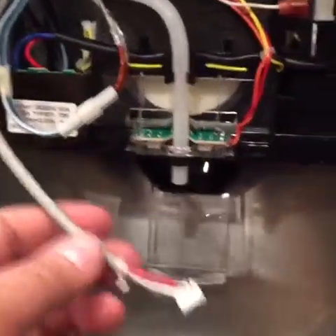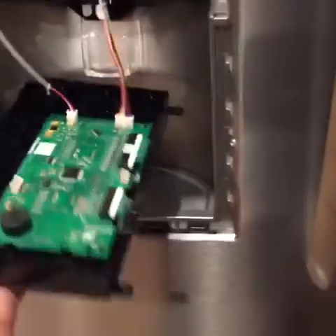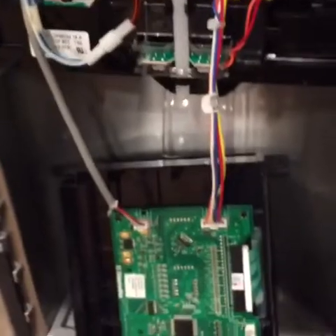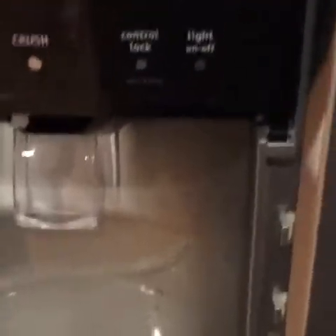The next step is to connect this panel. I'm going to hold this up with one hand and put this back on, along with this harness — it only fits one way, so you're not going to screw anything up. When you connect the panel, you're going to hear an alarm going crazy. That's just telling you that you need to manually close this little chute. With both connectors back on, we're going to install this — put the two tabs in on the bottom first, then put these two screws in, and then snap in the bezel.